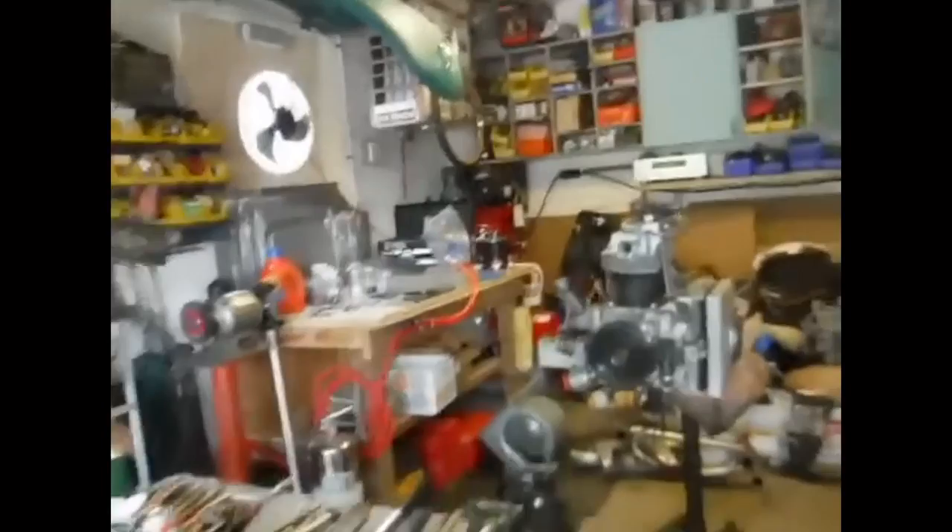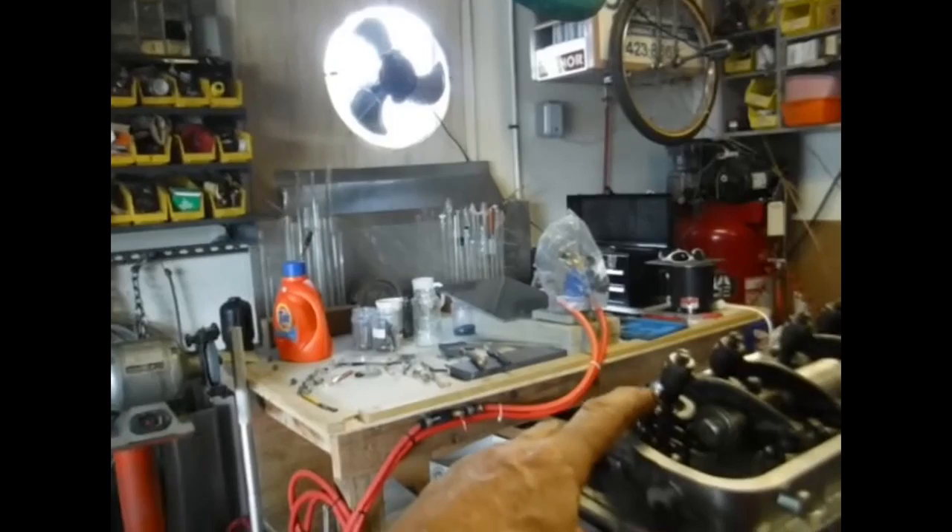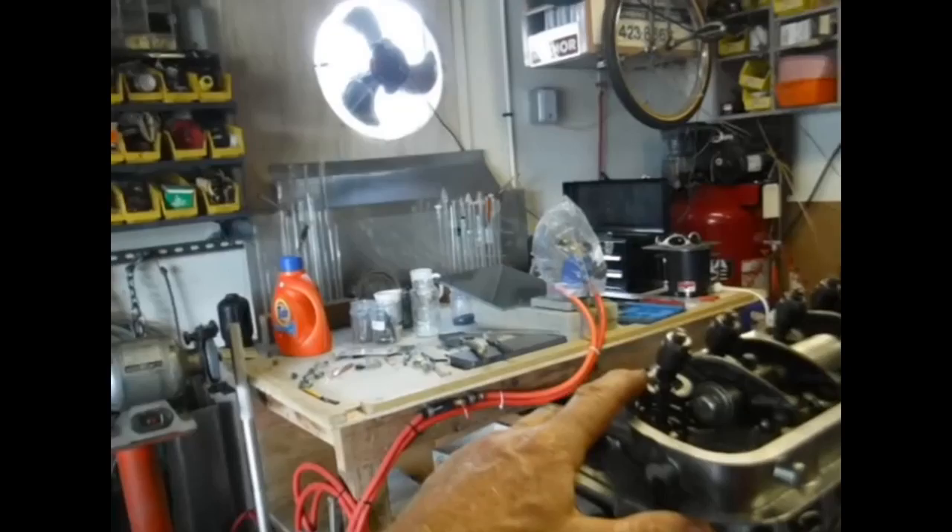So let's get started and get into this motor and take a look at it. I took it out of the car, put it up here on the stand. I wanted to check that coil bind issue again and since I have a dial indicator for measuring stroke, I thought I want to see exactly what I do have for stroke.